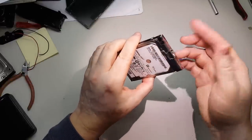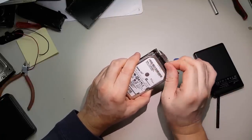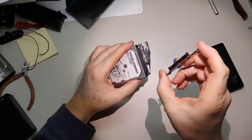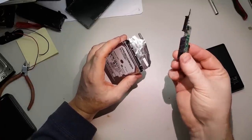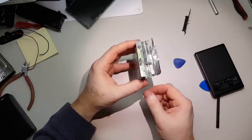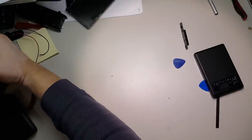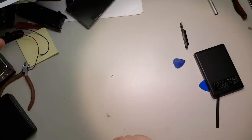As you can see, the connector is completely messed up — it's actually missing. But on the Seagate it's not really a problem, because in order to read the hard drive all you have to do is remove the adapter, which is a USB to SATA converter. I happen to have one from a different hard drive I've taken apart before. Put it back on — this one is a slim and this one is not slim, but it'll work — and I'll just plug it in.